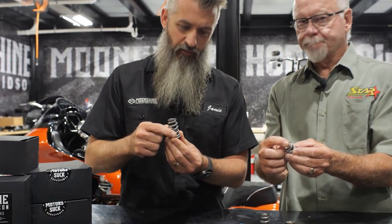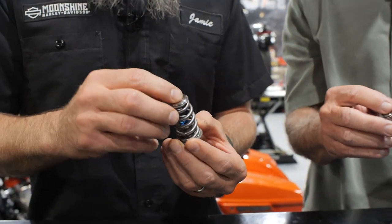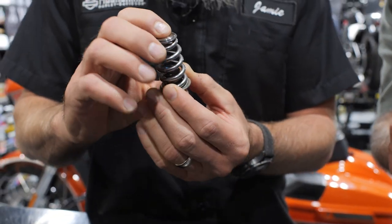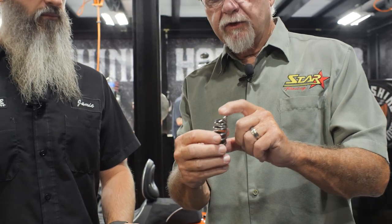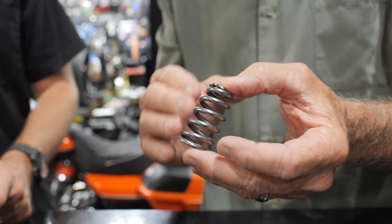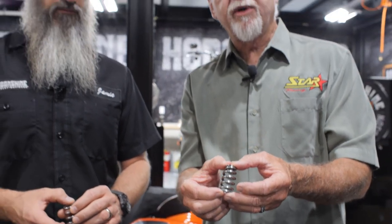We're keeping this real tight on the bottom — limiting how much the spring can walk around — and doing the same thing with the top retainer. This has very little movement. We want these to hold the spring as tight as we can from walking around inside this configuration. Another interesting thing about this spring is it's smaller in diameter and made out of a different diameter wire so we can stack it up tighter for more lift. Also, this spring and retainer combination is two to four grams lighter than everybody else's on the market, which means we can be in control at the same RPM that other packages go out of control.